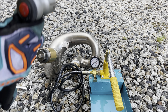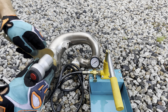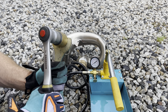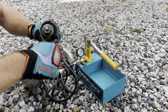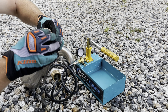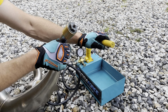Pop the end cap on with a 27mm socket — you probably have one with this tool. Grab it with the provided larger wrench and tighten it down. This part has to be pretty tight. Next, remove the bleeder valve from the top and fill the rest of the expansion chamber from the reservoir. You want to get rid of any air bubbles trapped in there, so let it bleed out a bit, then pop it back in. Give the pipe a little shake and then pop the bleeder back in.